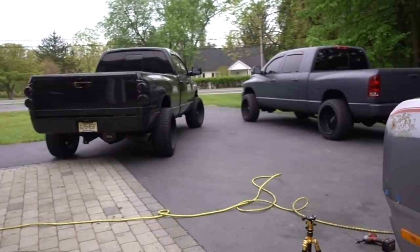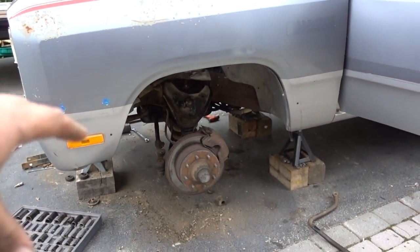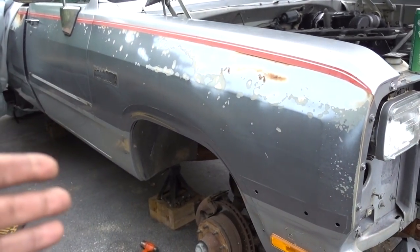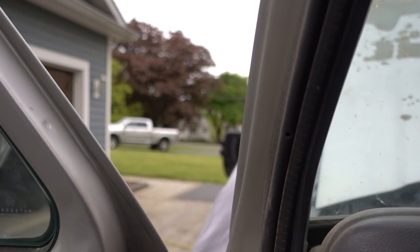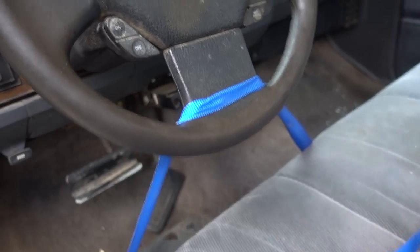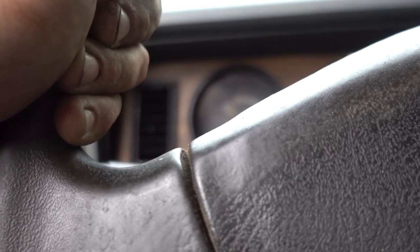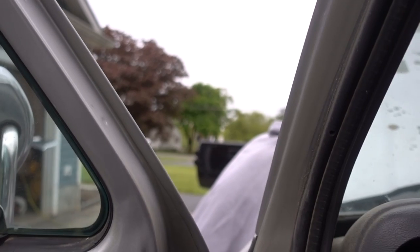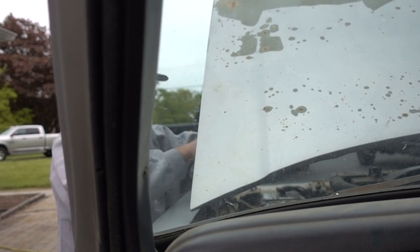To continue the randomness of today — we got all the suspension stuff out, actually started back on the eraser wheel, but right now we are back on the steering shaft with my man Ryan. We got the steering wheel strapped, and while he's loosening the bolts I'm holding it to make it a little more sturdy. This is a double-jointed steering shaft, so we'll go over what you need to do to modify that if you're going to throw one of these on your first gen.